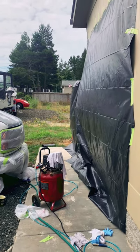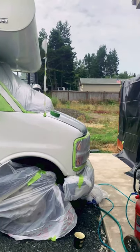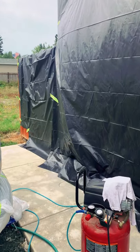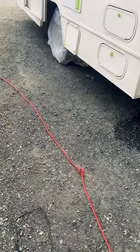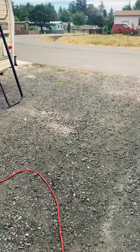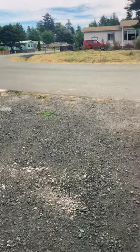The other thing we had to do — since we're painting outside by the house because that's the best spot — is tape off some of the house and the fence for overspray. Make sure you do this; it's very important. We're also going to spray the ground so that any dust, bugs, or anything like that stays on the ground. It is a little windier today, not too bad though, so definitely spray the ground.